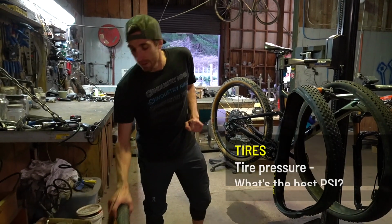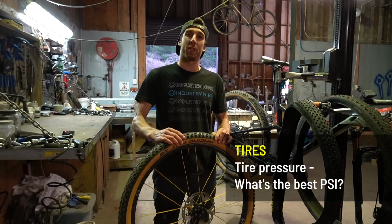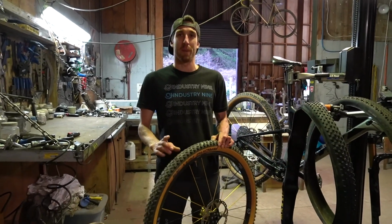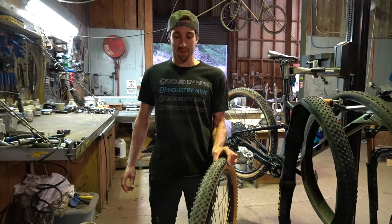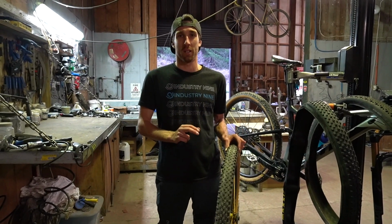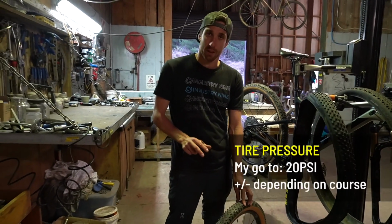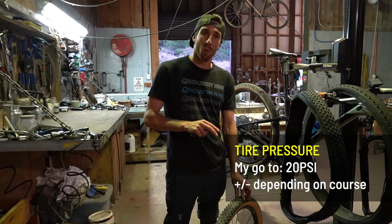To start with, we'll go with pressure. Now if I got $1 for every time I got asked this question, I'd be retiring well before I was 65. The most common mistake is people are always running too high a pressure. My go-to pressure for my racing is 20 psi. From there I add a little bit more or a little bit less depending on the course.